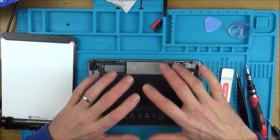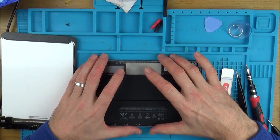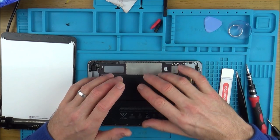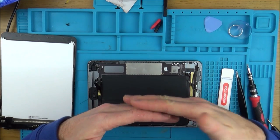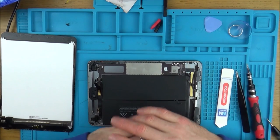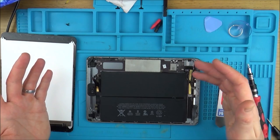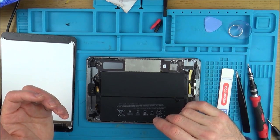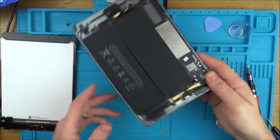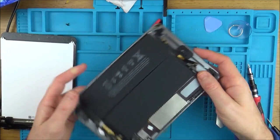So obviously this is what they'd done before — left the battery disconnected because it couldn't be fixed, possibly for safety. I'll get the main board out and have a look, but I think it's going to be unlikely. I can note down error code 4013 and Google it. I Googled error 4013 — it's not just for the iPad Mini, it's across the whole iPhone range as well. It's non-specific and can mean different things. Some people say it's USB-related, which would be fantastic — I could trace continuity from the port to the board. But more people are saying it's a NAND problem. On YouTube, people are taking off the NAND chip, removing the BGA solder balls and reapplying them, or programming a new one using a special programmer box. I'm pretty much certain it's not going to be repairable for me — I haven't got another board to swap parts with, and replacement boards are currently around £120-130 in the UK.